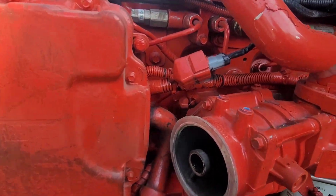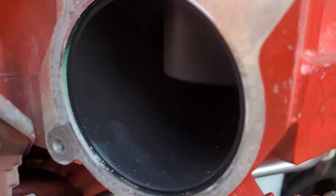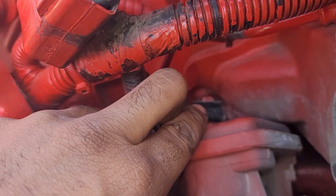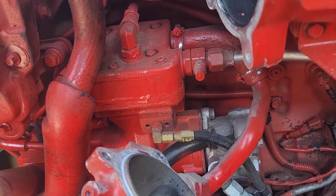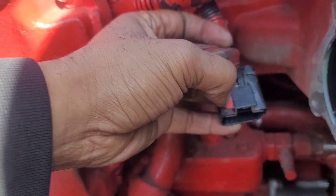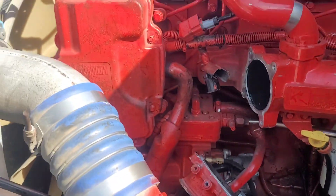That makes your job a whole lot easier. Now I can get to these four bolts and pull that off. This is the throttle — see how dirty that is. This is the intake, it's dirty, very crusty in there. I'm about to pull this piece out — it has a tab. You pull this little red tab up, slide that back towards you, and the piece should come right off. Also there's a tab in the back — you push this down to pull it out. Once you pull this up, that's the lock, then you do this and that opens it up.